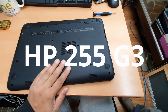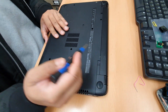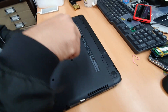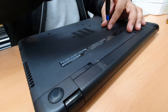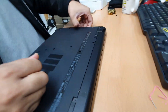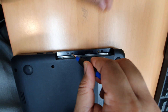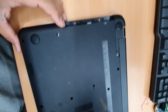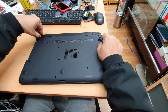So we're going to take it out. First, we need a Phillips screwdriver. Make sure your machine is completely off. As you can see here, this one screw goes to the keyboard, so we're going to take that out first. This one is for the DVD drive, and then under the DVD drive there are two screws - don't forget to check. Even Acer and Samsung use the same procedure. If you pull it without opening the screws, you're going to damage your front bezel.